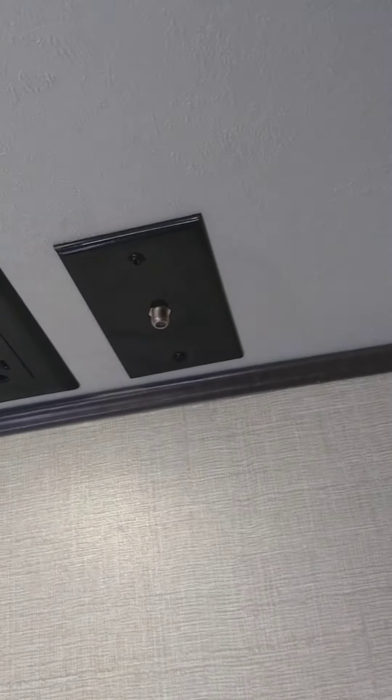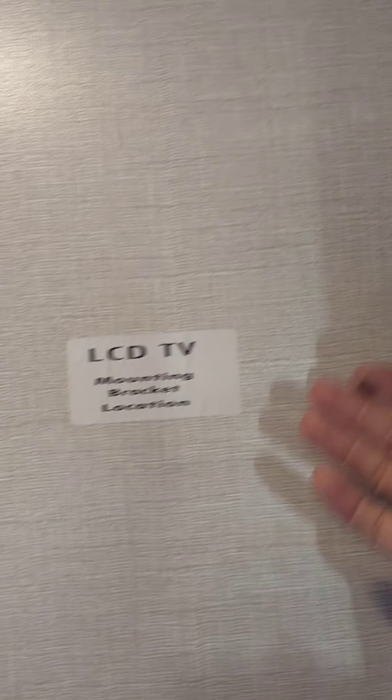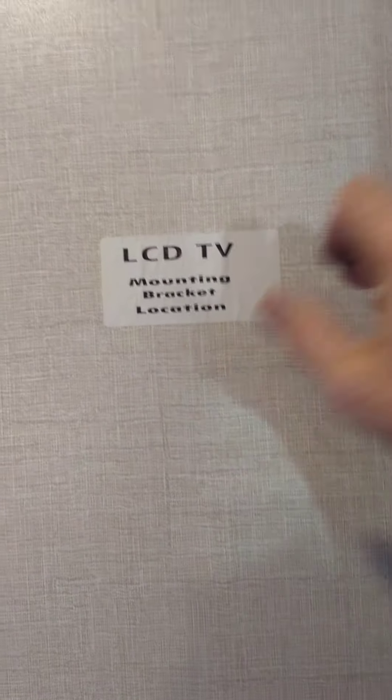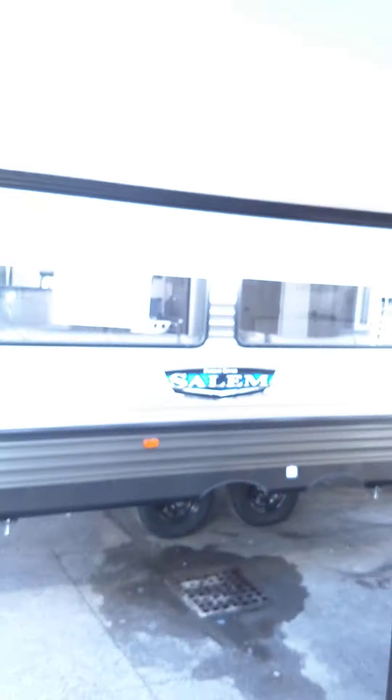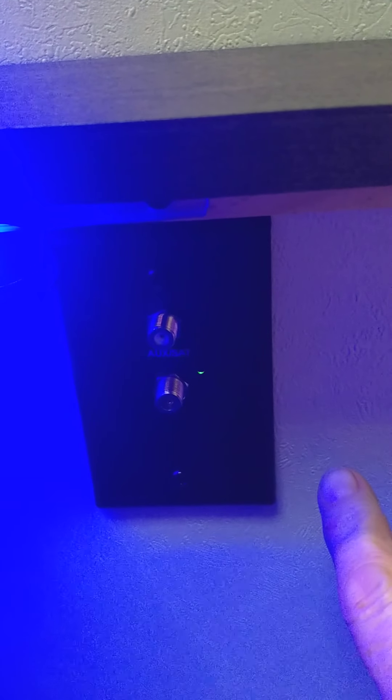There's a backer plate here for a TV — there's antenna out and there's power. You'll need a swing-out bracket here; spend the extra money and get a bracket that locks into place, because otherwise you have to hang a strap from it, which is unsightly. Get one that locks into place when you're traveling. Your TV hooks up to here, and that — see how that just turned on? That's the signal booster for the digital antenna. When you're hooked up to the antenna with your TV, you're always going to want this on — it should always be green. If not, you won't get a good picture; you'll have a lot of digital noise and it'll just outright lock up.